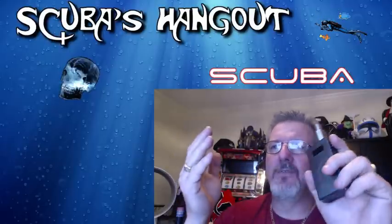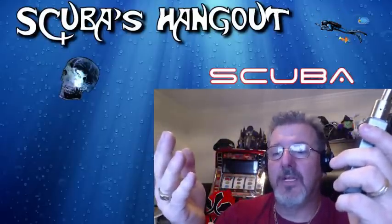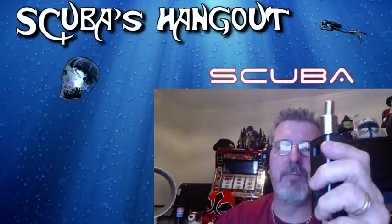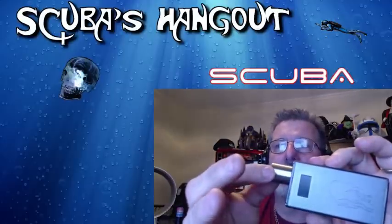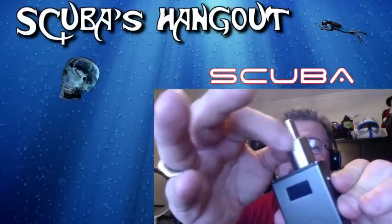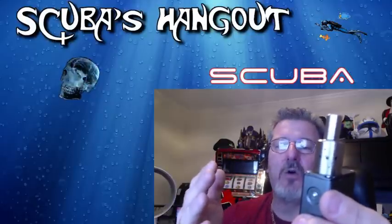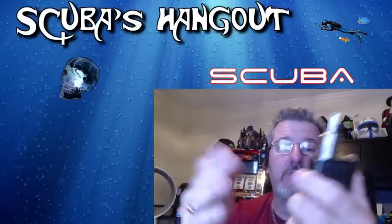So, if you have these symptoms like atomizer no link, or you may get it to where your ohms are jumping way up to 3 or 4 ohms and then back down. More than likely, what you'll find is that your RDA will wobble back and forth because your 510 connection is loose. And there is a way to fix this, and I want to show y'all exactly how it should be done to make it easier for you.